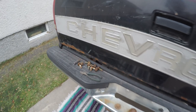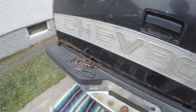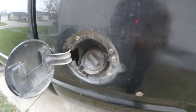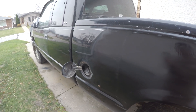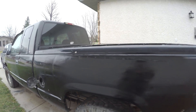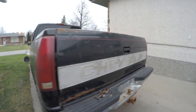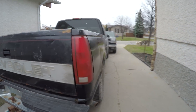Got all eight of the box bolts out, luckily no snapping. The bracing underneath didn't seem to be too rusty so should be good there. I'm just gonna unbolt the filler neck from the box and hopefully be able to bend it underneath and out as I pull the box back. There's also a ground under there I have to undo. If you're doing this yourself, go around underneath and make sure there's no other wiring or grounds still connected so you're not tearing stuff apart when you go to lift it off.